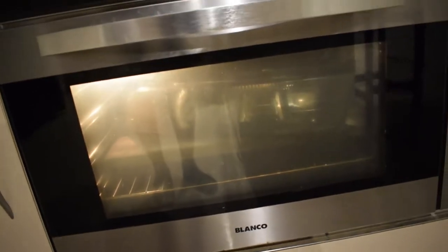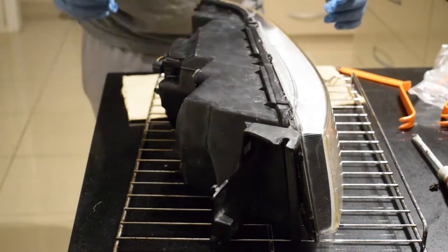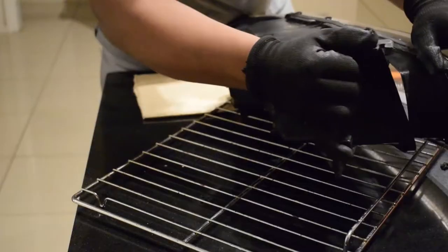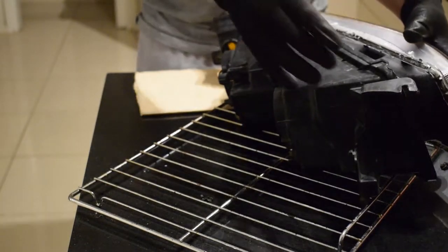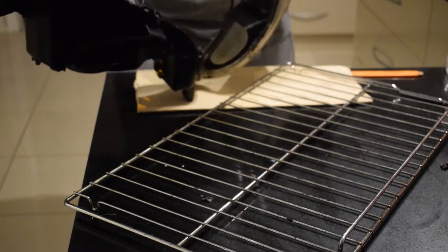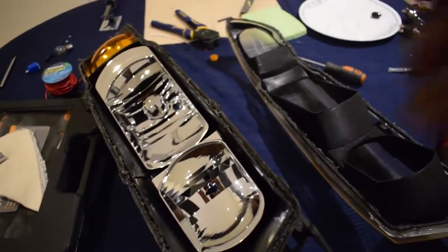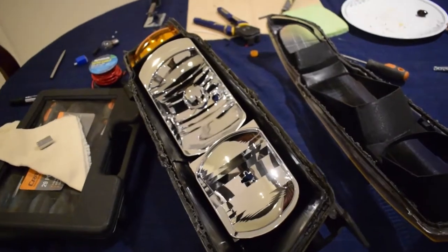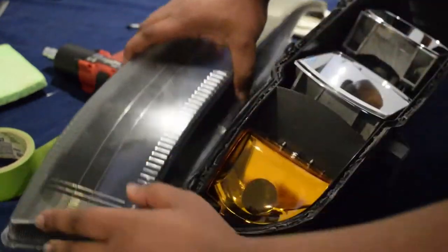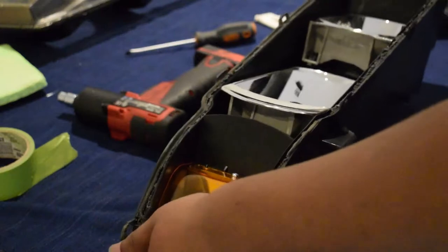Five minutes at 90 degrees Celsius - it had to go back in for another two minutes because the adhesive down here is just tough. We got the housing and the lens apart, and that went really well. After doing it the first time I was much more confident and I've got a lot less patience. You absolutely do not want to be getting fingerprints or dust on the inside - the outside's fine, they're gonna be sanded anyway, but the inside is a whole different ballgame.